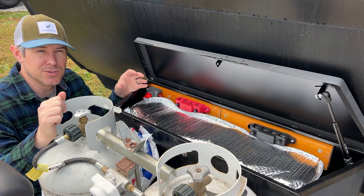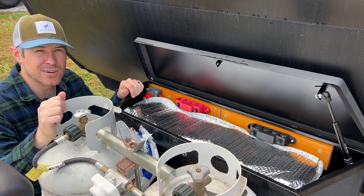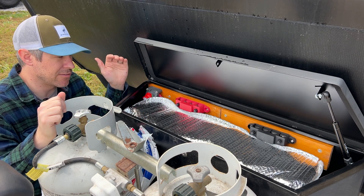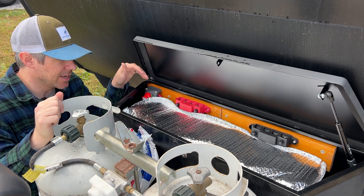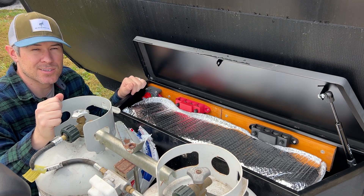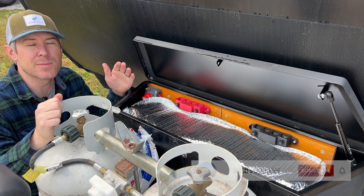There are just so many things that I want to be able to shut off at once and also prevent so many different cables from being hooked up to the posts. So I've cleaned it up by adding these bus bars and an integrated shutoff, which will shut everything off to the batteries so I can safely work on them, remove them — you name it.